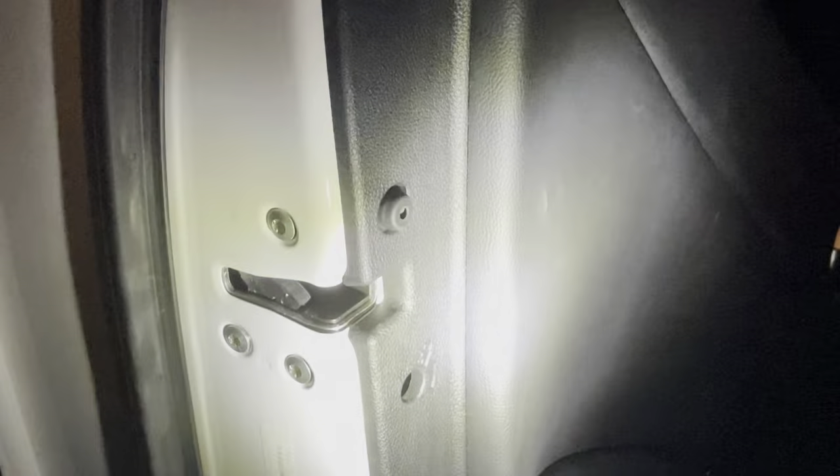So I'm going to show you how to replace the actuator. Let me unlock the door first. What it is: I've got to replace the actuator inside right here. When the door closes it sends a signal saying it's closed, and when the door's open it opens that circuit so it says the door's open. I've got to take the door panel off.